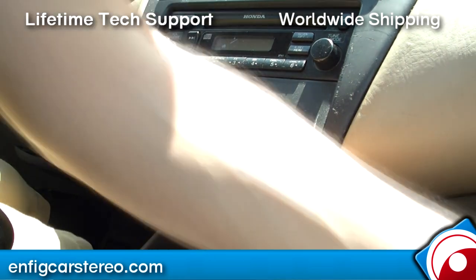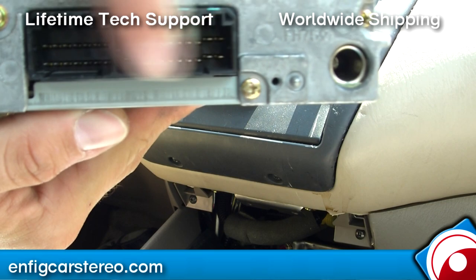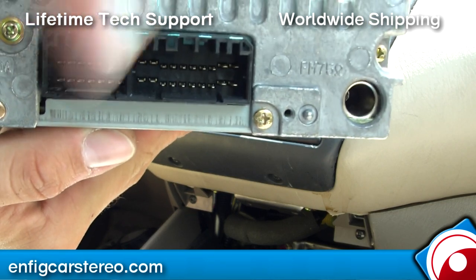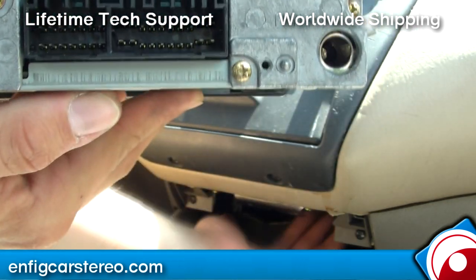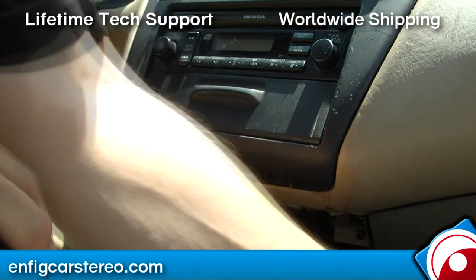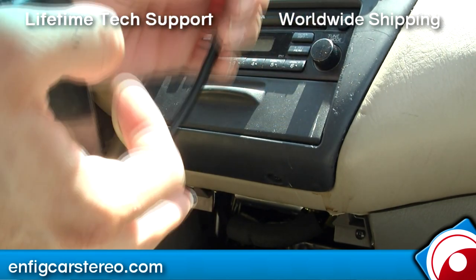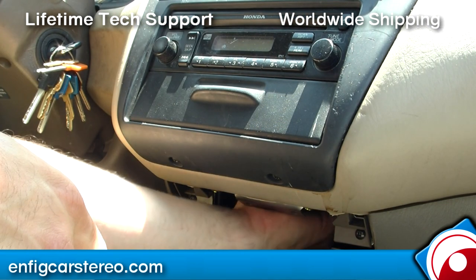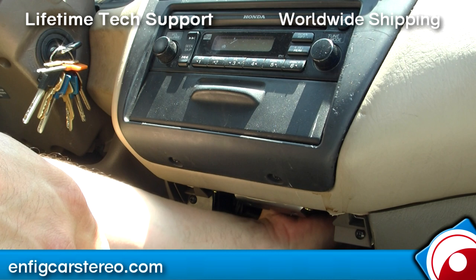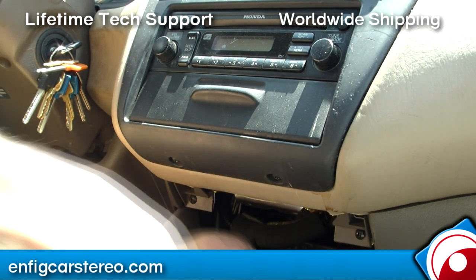This is how you install it. When you look at the back of the radio, this is where the power harness is, and this is where the adapter plugs in — it's supposed to be empty, and it usually is. Just put your hand back there and you'll feel some pins. The pins are good. So you just take the black box with the harness and plug it right in — straight towards it until you feel a click.